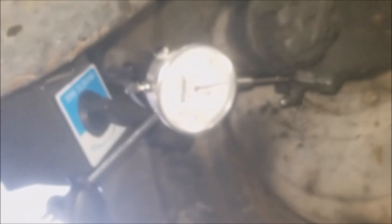Welcome back. As you can see, I've transitioned over to the bottom kingpin and we're going to go ahead and move it. If you look at the dial indicator, we have about ten to twelve thousandths of play on the bottom as well. Once again, it's within manufacturer's spec, which is two to forty thousandths for a used kingpin.